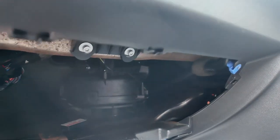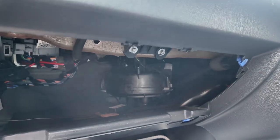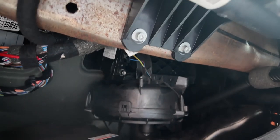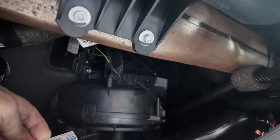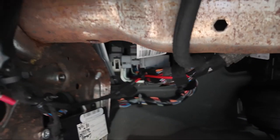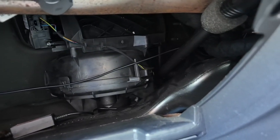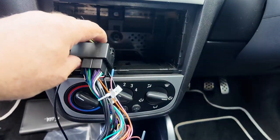To make it a little bit easier I've taken the glove box off — two screws at the top, two at the bottom, slides straight out — so I can get behind and put my bits and bobs wherever I need to. I've got a dash cam and a black box in there as well. Feeding wires down — I've got the aerial wiring, the GPS stuck up there, and my DAB antenna feeding through the back of the dash. We're getting there — block connector is on now.